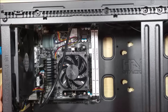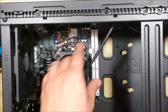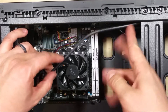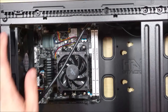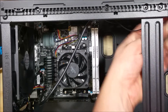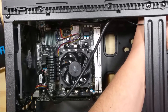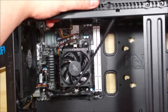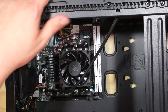So far we have all of the rear fan and all the front panel connectors put together. What we'll need to do is provide power from the power supply to the hard drive, the hard drive SATA cable from the motherboard to the hard drive itself, and we'll need to put in the additional 12-volt CPU cable. We'll go through all those steps here in just a few seconds. Just trying to manage the cables a bit to get a clean installation and a better view.